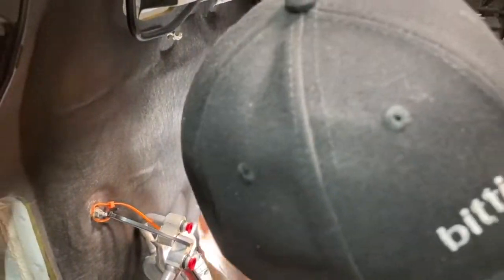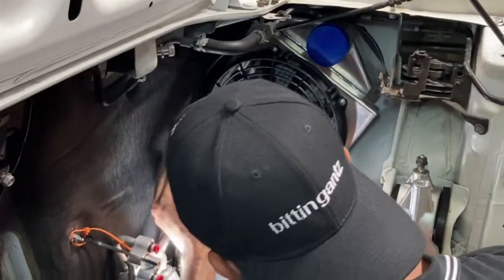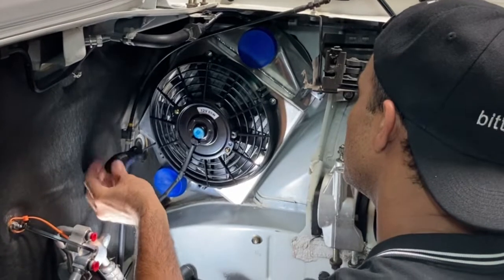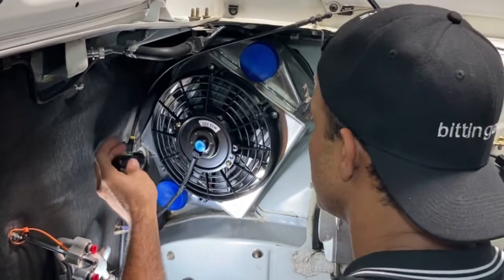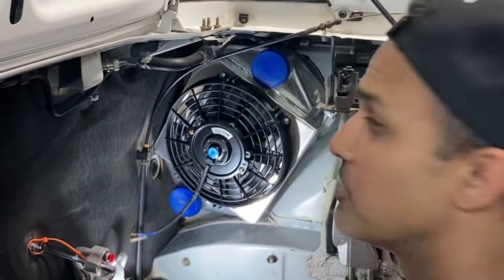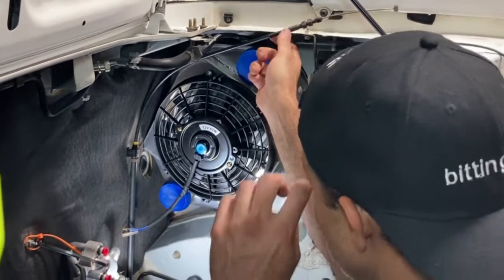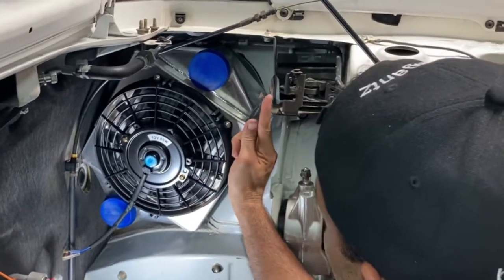And then these screws, I'm probably gonna do the same like I did with the studs. Just put some blue Loctite on them, so for vibration or whatever, they don't fall out, right? So there you have it. There's the intercooler. So the TCS intercooler kit, it's installed. Now let's talk about this throttle cable. So before, this thing was vertical up, right?